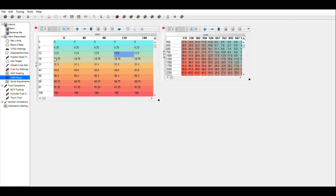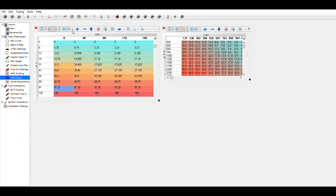In sport mode, you'll notice it's closer to a one-to-one ratio. KTuner said that 83 is virtually 100, so we're going to change it all to 83 across the board — when we put our foot down 81 percent, we want it to read 83 percent. Eco is lower: when you put your foot down 6 percent it reads 3 percent. You can also change settings for all the gears — in 6th gear we're not expecting the car to go wide open throttle all the time, so at 10 percent it'll only read 5.